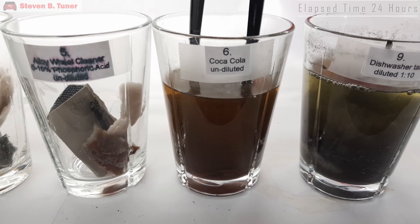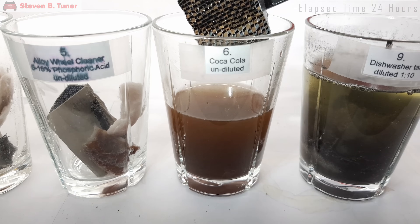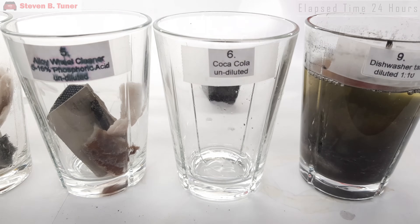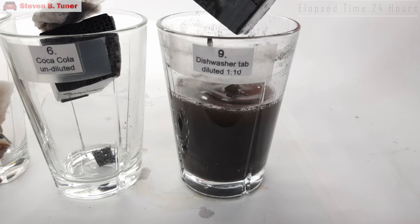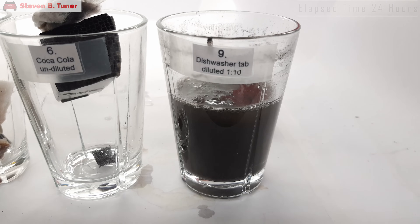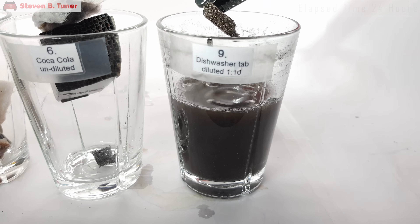The cola was a real surprise for me in this test. It worked really well, considering that it is not even a cleaning product. It hasn't removed all the ash from the channel walls, but I get the feeling that two rounds of cola might work really well — let me know in the comments if you want me to do such a test. The glass fibre and stainless steel are in good condition at the end. The dishwasher tab was another real surprise — it took care of oily soot as well as removing heaps of ash buildup. It worked even better than the drain cleaner, so it is going to be my new favourite pre-wash in any future diesel particulate filter cleaning videos. And it didn't do anything destructive to the glass fibre or the stainless steel.